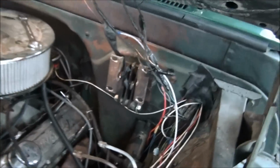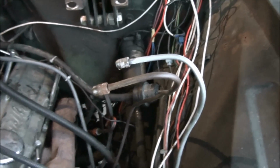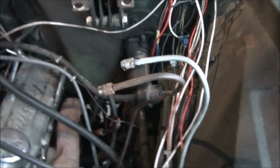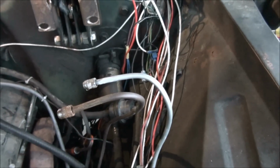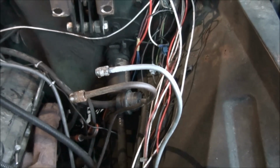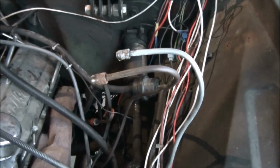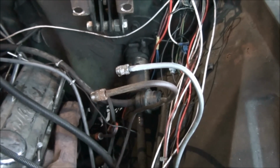Okay, that's simple. That tells you right there you've got independent front brakes. Well, what are we going to do with the back? Well, the back brakes are real easy too. You go over where you took it loose from that junction block, you use a brass union, not a compression fitting, but a union, and you take another length of brake line, which is that shiny line right there, and you route it back up here and you plumb it into the brakes. Simple. You have front and rear separate cylinders on the master cylinder. You blow a front brake line, you're not royally screwed, you've still got brakes. But this old system with one line, you're pretty well screwed.